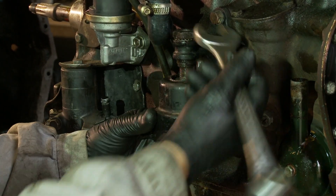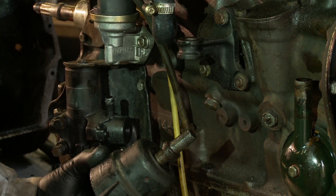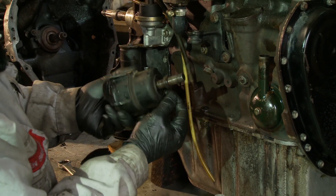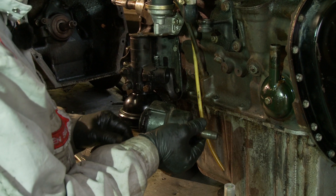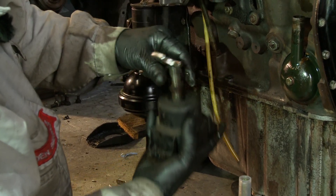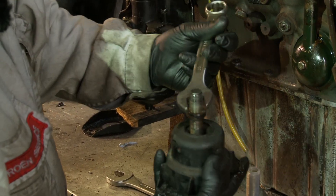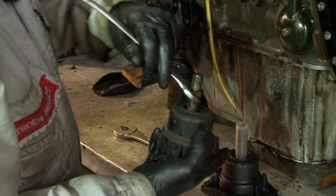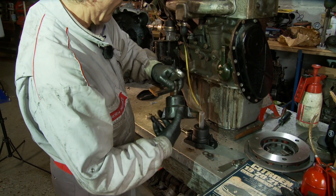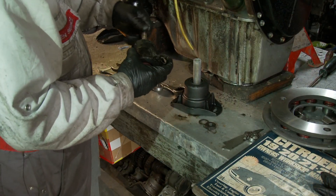I've already slackened off the nuts and have previously adjusted it. What we've got is a top nut and bolt, but we've got this special shaped bottom nut which I need to wind off. It's only got two flats - it's not a full nut with a full hex on it. We have to unwind this and put it onto the new engine mount. A lot of unwinding.